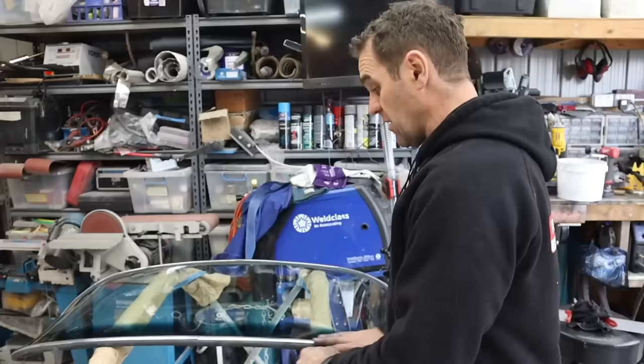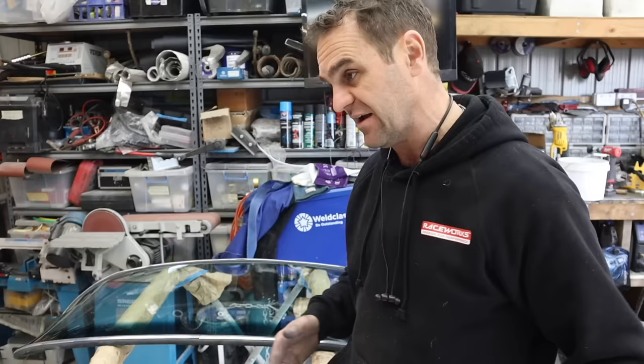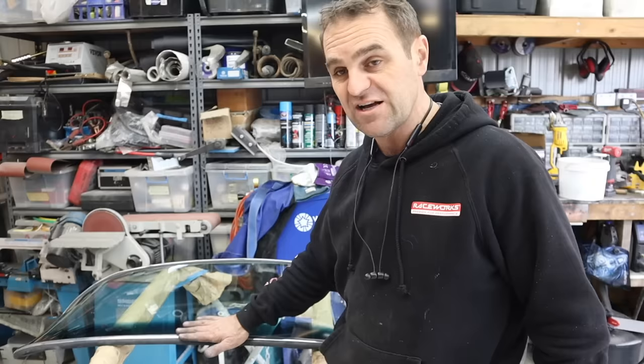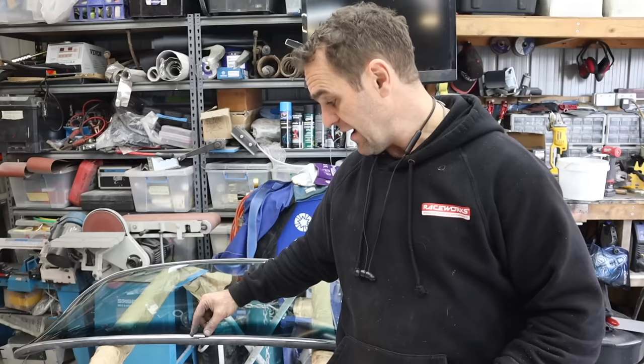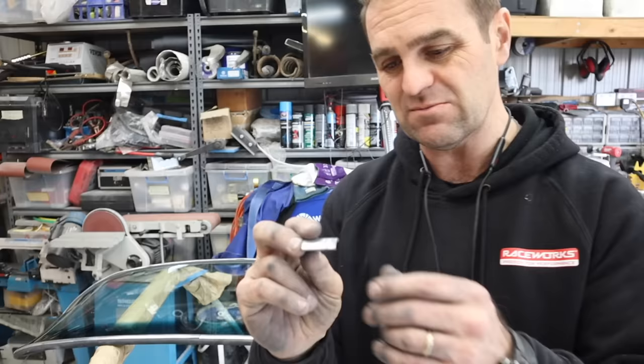That was not too bad but did take quite a bit of time. These aluminium trims were actually anodized from the factory, and now 50 years later the anodizing is pitted and horrible - you couldn't bring it back. Had to sand the anodizing off and then polish them up. They will require polishing once a year. Also, I only have three of these little joiners - the pieces that slide over where either side joins on the windows - and I need four: two for the front and two for the rear. So I'm going to make one out of some aluminium and see how that goes.